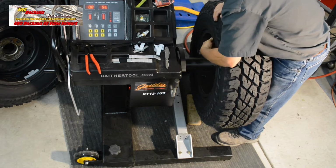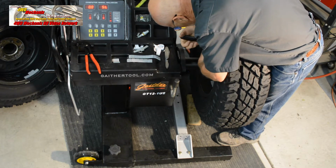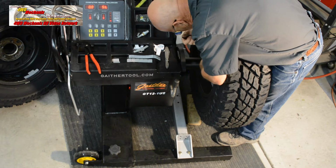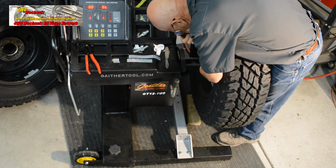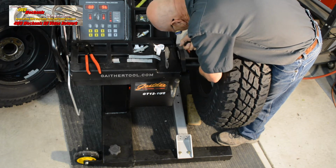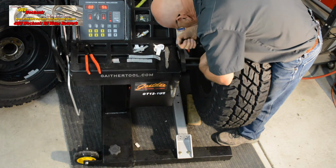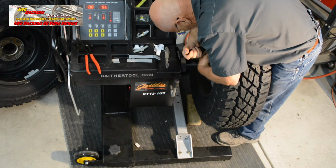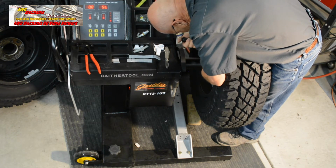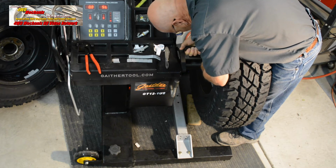The tires are not at fault, though new tires often get blamed for imbalance problems. Consumers and frustrated tire shop personnel condemn perfectly good tires when the aftermarket wheel design is at fault. OEM alloy wheels generally have clip-on weights applied at the outer edges of the rim flanges, for good reason. This spaces the weights far enough apart and at the outermost point to assure a dynamic balance. A dynamic balance can be quite accurate when the weights ride at the outer flanges of the wheel rims. Wider aftermarket rims with wide interior spacing are better candidates for tape-on weights than a narrower aftermarket alloy rim.